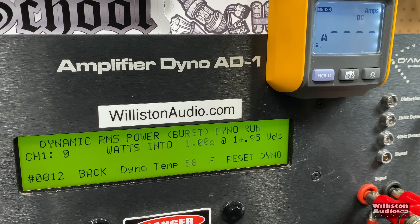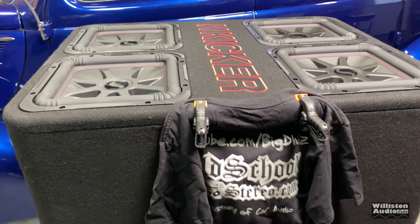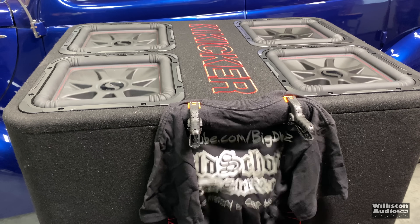Dynamic test at 1 ohm with higher voltage — the results are erratic, showing strange oscillations. I'll have to ask Tony what's going on, but I think it's related to those weird voltage oscillations from this amplifier. That kind of sucks, because for the price I was thinking this is a really good deal for the budget bass head — but if it's going to do weird things to your electrical system, I would not even try to recommend this. Pretty intense.